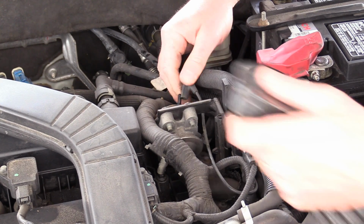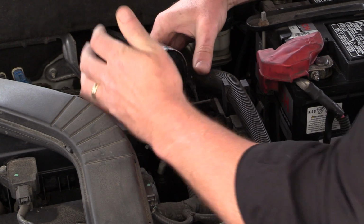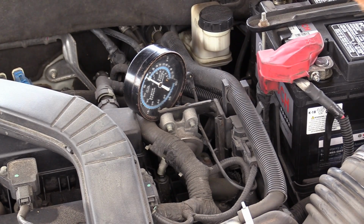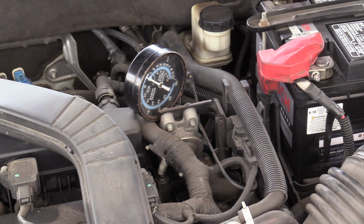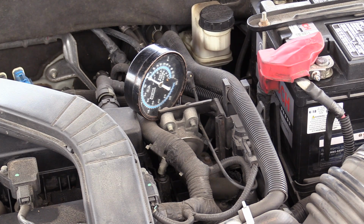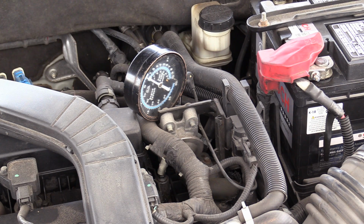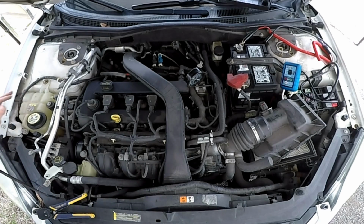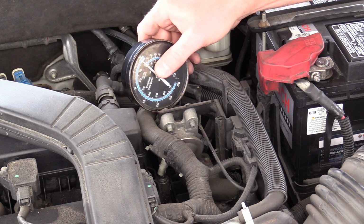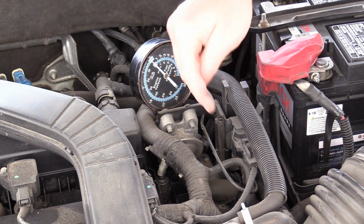Okay, so vacuum to this diverter that I just unplugged is going to come from the solenoid right here. And it has a vacuum supply, so I haven't eyeballed that yet. I should have maybe even started with that. Let's eyeball this vacuum supply line. That is this one. Goes under the manifold. It's still connected, not broken. Okay. What I want is vacuum to go to this valve whenever we start the car and I energize this solenoid.